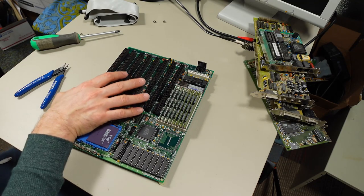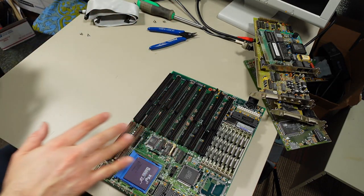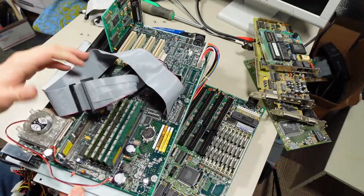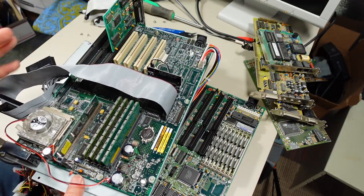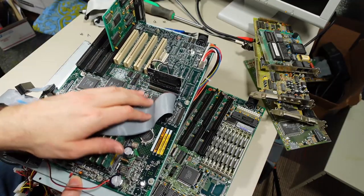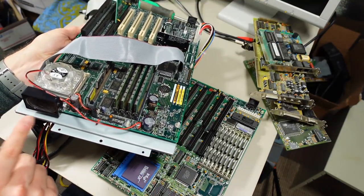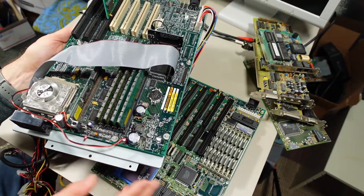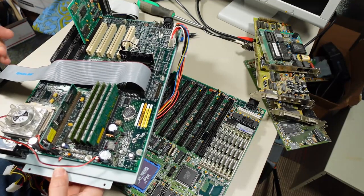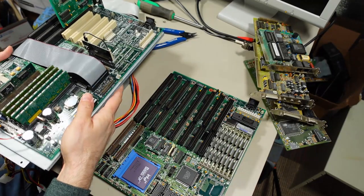I want to test this motherboard, but I don't want to use the power supply that's in the case initially — I want to test this on a known good power supply, just in case that power supply is bad. Here is my test bench. It's got a regular AT power supply, and it's just a standard Pentium motherboard I took out of an old computer ages ago that I use primarily for testing. It has ISA slots, PCI slots, onboard IDE, and a compact flash to IDE adapter that just plugs straight into the motherboard. I have a speaker attached permanently and the fan powered directly off the motherboard. So I just don't have a bunch of cables — it's super easy for testing everything, and I totally trust it to test this 486 board.